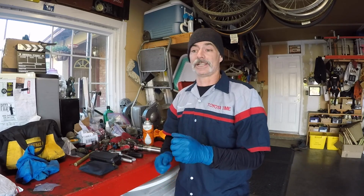Part of my research is I looked up other YouTube videos and I saw some techniques that people use. One was using a ball joint C-press. Another technique was just using a bench vise. And a third technique is you just use a couple sockets and a hammer and you drive the bearing cups out. Since I have an OTC ball joint C-press, I thought that was going to be my go-to tool.